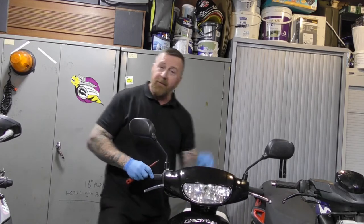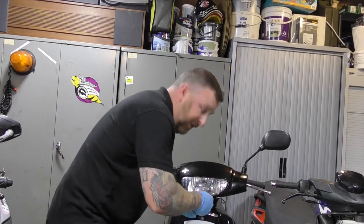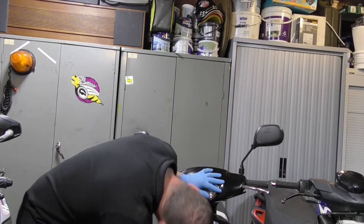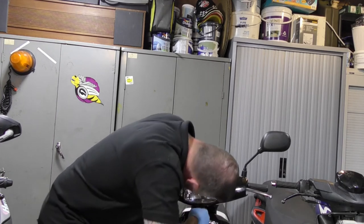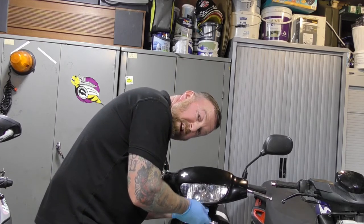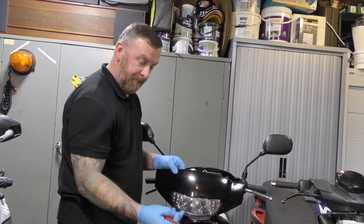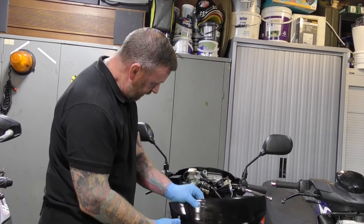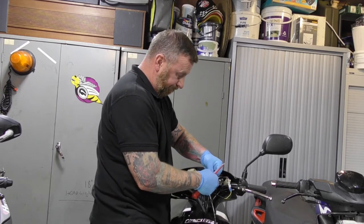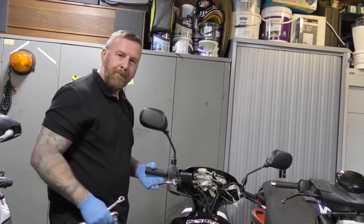In this particular model we've got three screws — two at the back and one at the front. Don't just try and rip it off. There's also another screw that adjusts your light — you're not looking at that one. Try not to drop it down the front fairing, it'll just really annoy you and probably won't come out. That one's a slightly longer one. I suggest just undoing the little plug — a simple little clip plug — just to stop this from dangling. Place it somewhere safe.